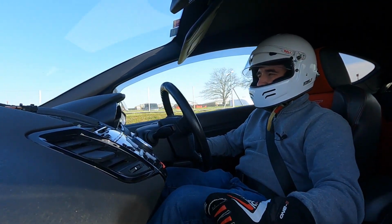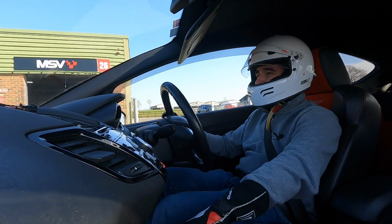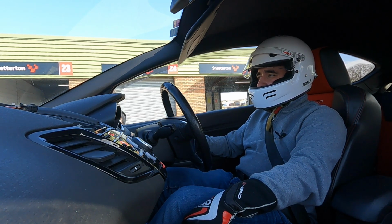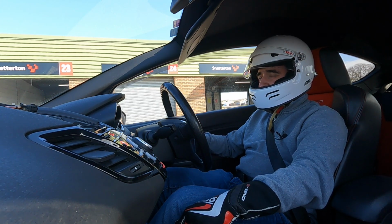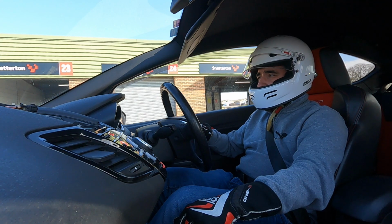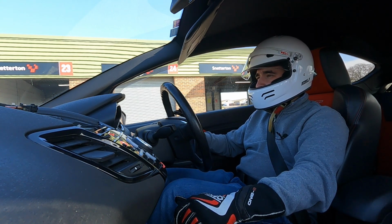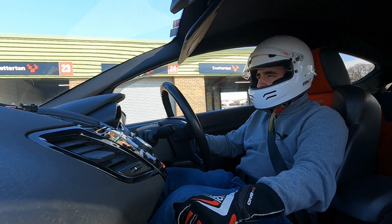I run Eagle F1 asymmetrics on my road cars, even my BM to be precise, and I have to say they are awesome and I swear by them. I recommend them to anyone. But yeah, it's just a shame that I couldn't get them in 17s, because I think it would have been a lot nicer. You would have got a lot less unsprung weight, of course, and I should think just better feel in turning. Now, turning is actually surprisingly good considering the size of the wheel, and I used to run 15s on this, well still do until the next few weeks, where I'll be putting my 15s back on after the testing concludes. The steering does feel positive, very nice. You feel a lot of feedback through corners, I have to say.